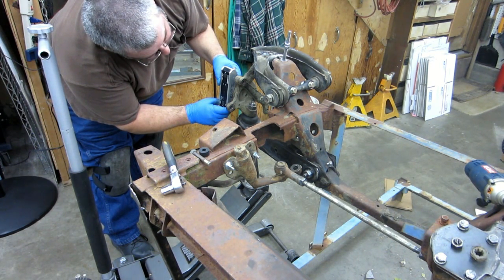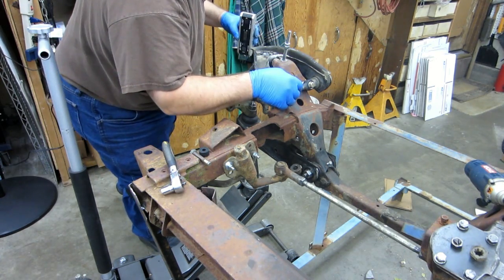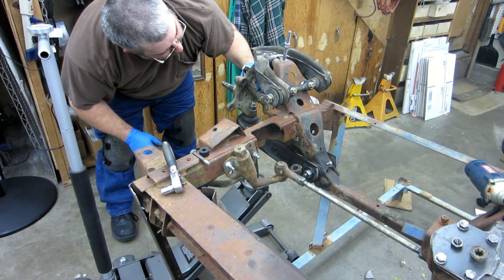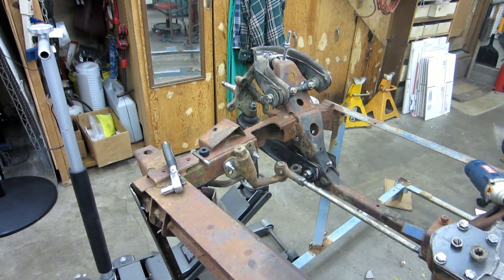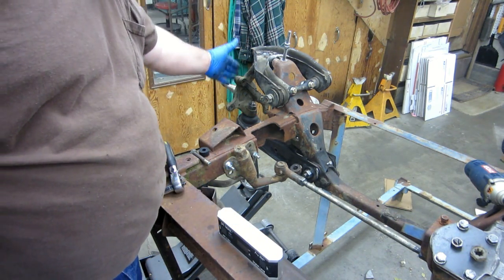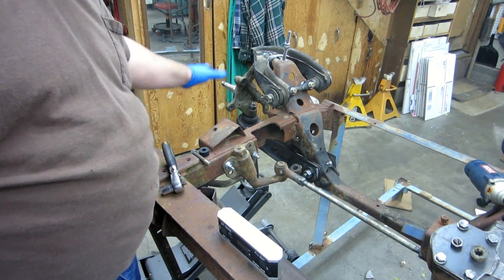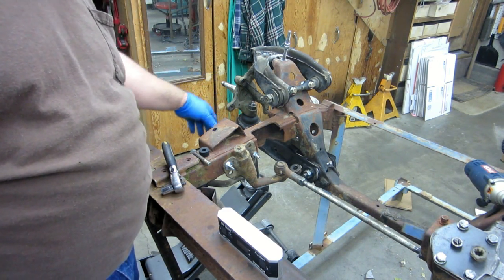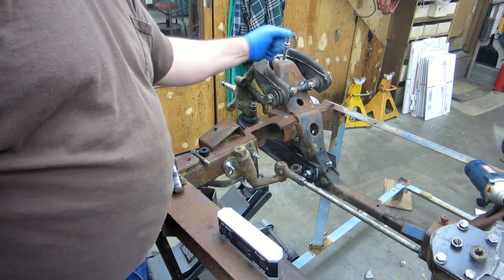It says 87.3, which means the top has to tip out a good three degrees. That means with roughly a half inch spacer in there — I'd have to measure to be sure — I've got 87 on this side too, so I could actually take a washer or two out. Will it hold stock track width? I'm not real sure, because the lower control arm was at a downward angle on the other side at stock track width, which means on a level surface it's going to be just a little bit longer.